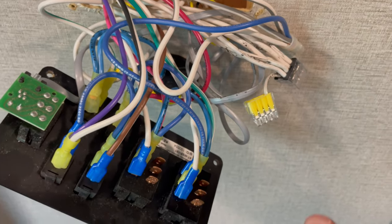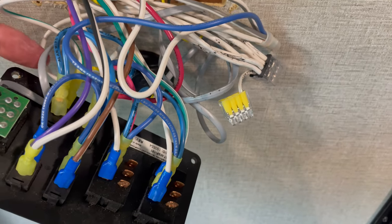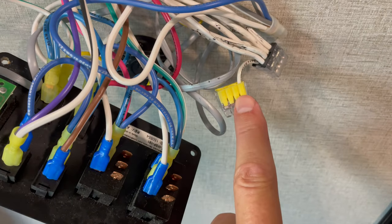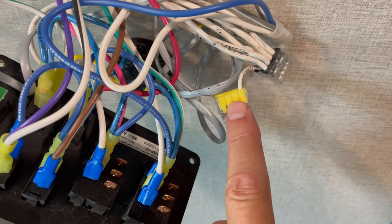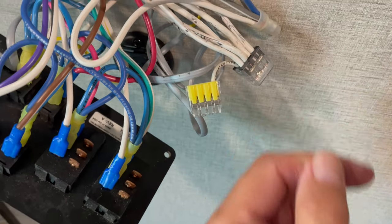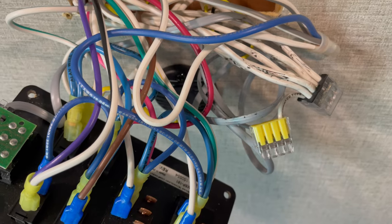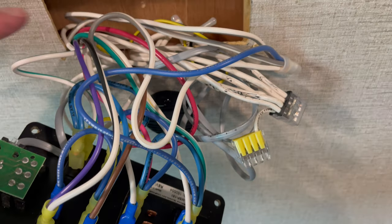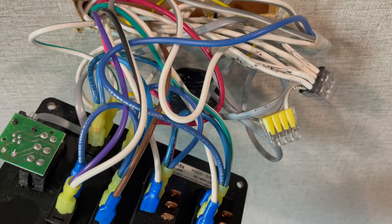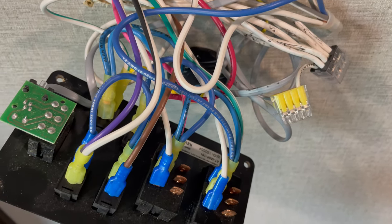There's one more extra wire, one that is not attached to the Shelly PM1, needed to connect the bottom post of the switch to the ground of the camper. It will have the female spade receiver so it can be placed on the switch. Make sure you have enough wire to reach the push-in wire connectors when making any of these wires. Most of the wires only need to be a couple of inches, but in some cases you will need to make longer wires, especially for the connections to the switch.